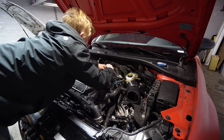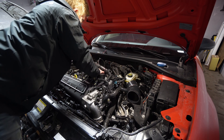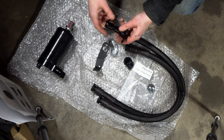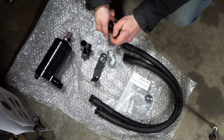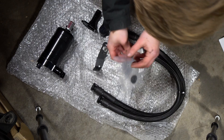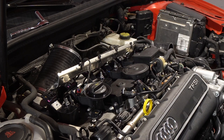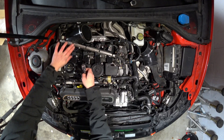Okay, first thing with the Forge components: lock your car so that your mirrors are folded. Make sure your O-ring is down all the way, thread that on here — this is the adapter for the PCV — and thread this onto here. We've got our adapters for the OEM PCV system, then we will put this part into here — just a push fit like so. Then we will take these 10-millimeter bolts holding cylinders two and three coil packs.